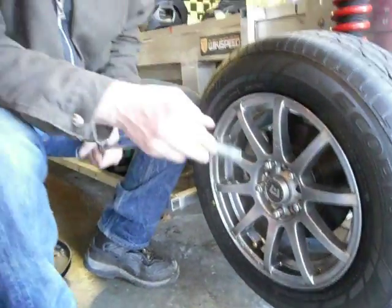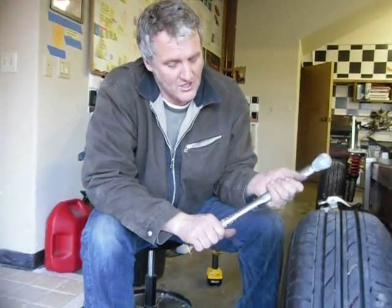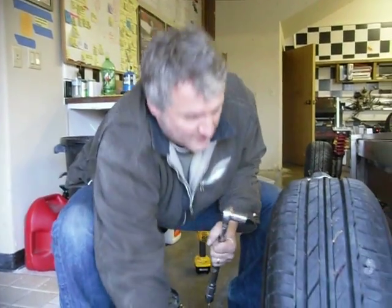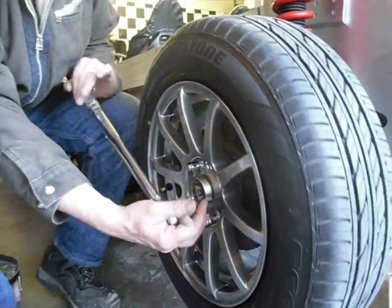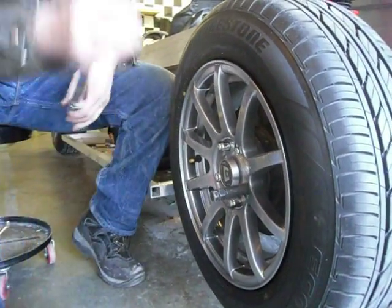Ideally, I set them to the correct torque. Those torques are usually listed by manufacturers — that's the twisting force that you're trying to actually achieve. You can get that exact with a tool like this: a torque wrench. You turn the handle and set it to whatever foot pounds the reading is. As you're tightening the bolt, when it exceeds the twisting force you've set it at, the head will kind of kink over — that's your signal to stop, that you've achieved the intended torque. Be particularly careful when using aluminum parts, because going to the exact torque is usually very important — aluminum is not as strong as steel.